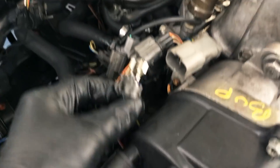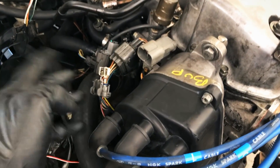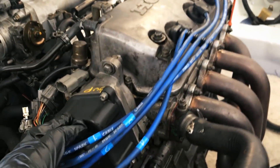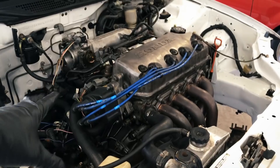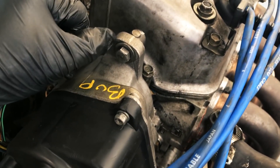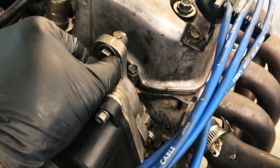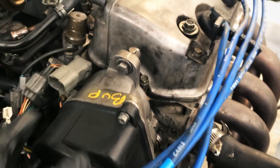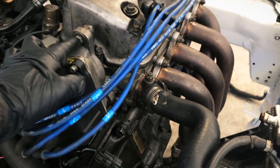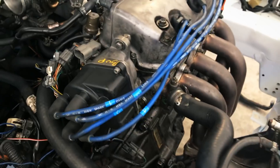Look at this — that connection is already undone and I'm going to be messing with that after all this. You see here we've got the three bolts for the distributor holding the housing to the head. If you haven't touched or taken that off before, go ahead and mark the position with a Sharpie right around where your position was, so when you put it back on it goes in the same spot. These I believe are 12-millimeter.